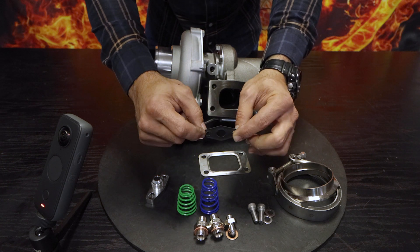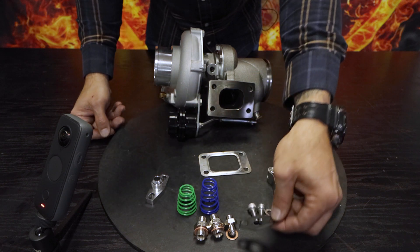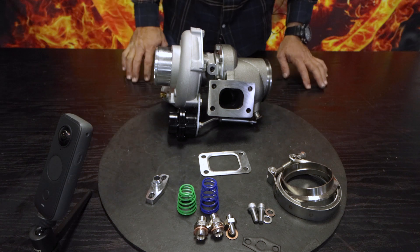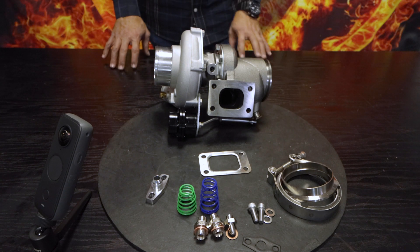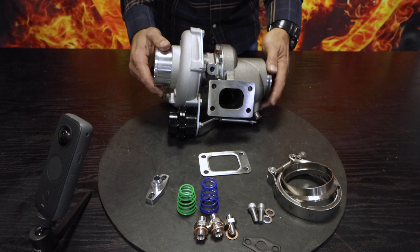You also get a gasket with gasket material infused onto the top and bottom surfaces, mounting bolt, V-band flange, and V-band clamp — making this probably one of the most comprehensive and complete little packages you can get for your small size engine, with horsepower ratings from around about 380 to 430 horsepower. That's the gist of the GTX 2563 turbocharger — nine blade turbine head.